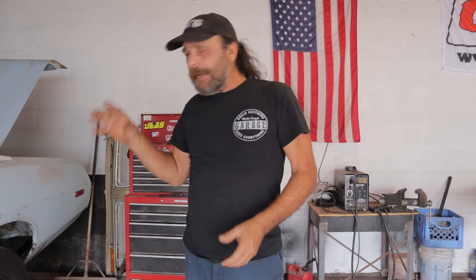The fastest cars at the time — remember, all this stuff was brand new — were running with off-road kits, gears, shorty belts, and different computers and processors. And they were only going like 13.50s to 13.60s. So by just focusing on efficiency and making the car with the parts it was born with as efficient as possible, I was actually able to stay ahead of the pack. There's even a picture published in Cars Illustrated magazine showing the car launching with the left front wheel off the ground — actual daylight between the tire and the track. I used to take the car to private test sessions and launch it 30, 40, 50 times, then run a 60-foot and then a 330. I kept taking little chunks out until each part of the run was down to perfection. It got to the point that before the car actually moved forward, just by the way I came off the clutch, I could tell to the hundredth what the car was going to ET. That's efficiency — becoming one with the car.